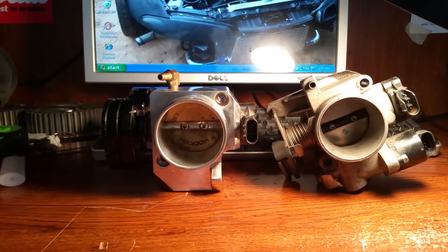On our application, and a lot of other applications, the problem with running a bigger throttle body like that is you're going to run into the intake manifold not being the right size to support it. We have this intake manifold here — which is actually a factory 420A Eclipse manifold — and if I open the throttle plate you can see there is excess intake manifold material there; it needs to be bored out. You can see the difference right beside it: the intake port of the manifold versus the port of the Modern Performance throttle body. A lot of cars cannot just accept the bigger throttle body from the factory; the intake manifold is going to need some modifications.